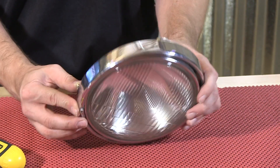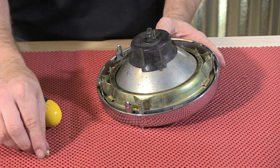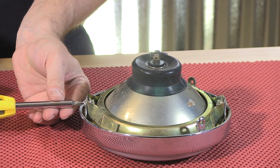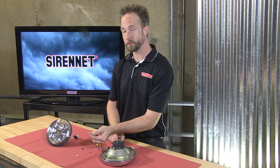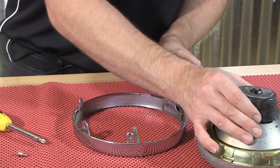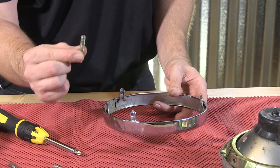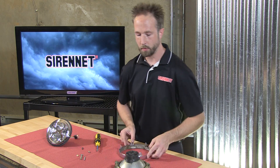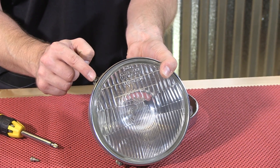With our light angle screw completely loosened, don't forget to keep an eye on this small plastic square retainer on the back — because if you lose that, you are going to have a hard time finding a replacement. We'll now follow over to the other two retainer screws into the bottom of the housing. And with the removal of those two small retainer screws, we can separate the bezels.